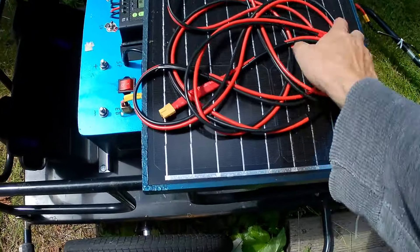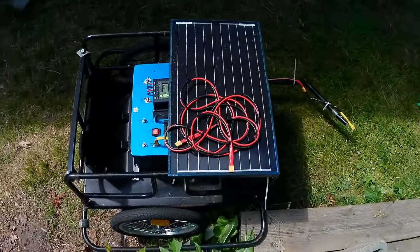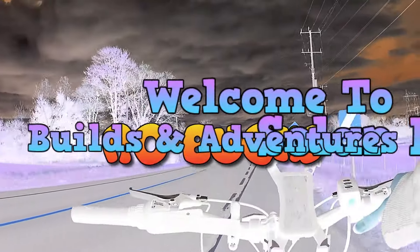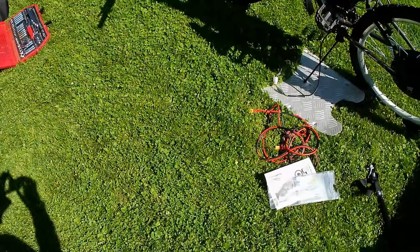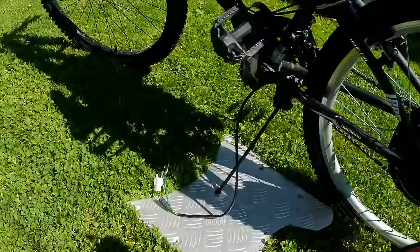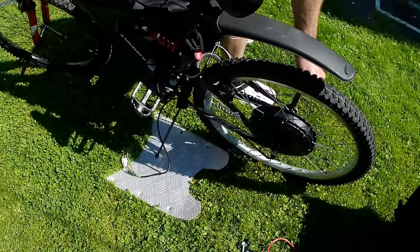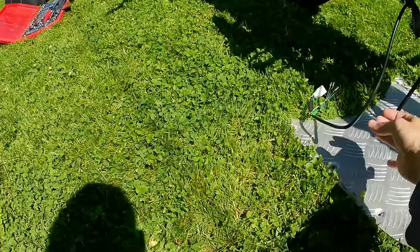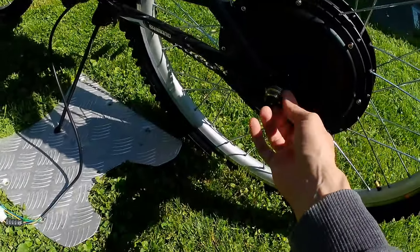Toon's got his trailer hitch figured out and I've got his wire made. Let's run over to his place and finish off his trailer. We're here — I just got to attach this cable so his battery can go on the trailer. He's already drilled the trailer hitch out; it wasn't big enough for that spot. We just gotta take the end clip off so we can put the trailer hitch through, thread the wire through the trailer hitch, and put the trailer hitch on.